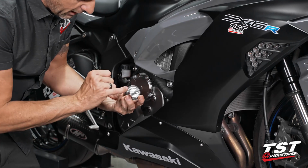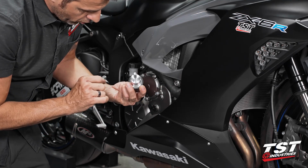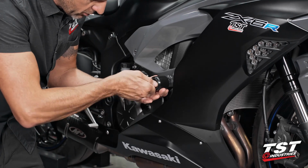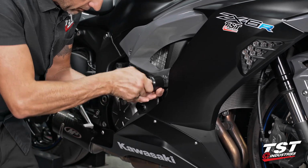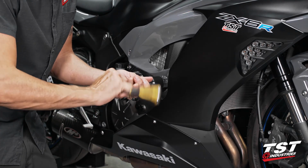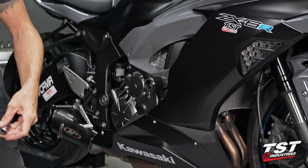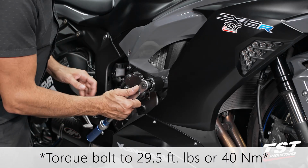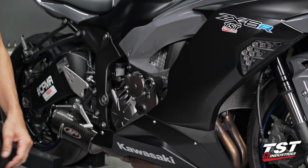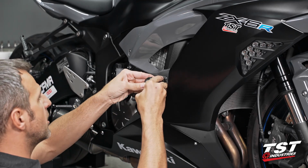Here it becomes evident why we have the counter bores. There's an adjustment mechanism here. Two different diameters here fit all inside our spacer. Engage that thread by hand, then switch to my 17 millimeter socket. Get that bottomed out. Grab the torque wrench, same setting. And finish up with the cap. After this, we'll move on to the fork slider.